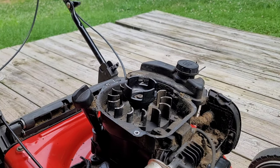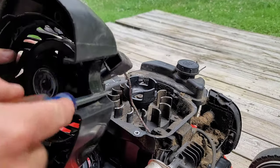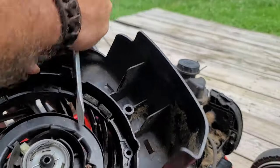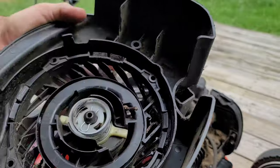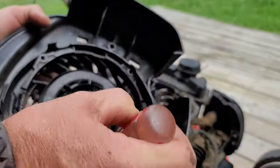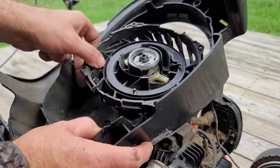Now you're going to need a flat screwdriver. The old cover goes to the side - keep the part number for later. You've got this cut-out right here, and your handle goes to that cut-out when you snap it back in. The easiest way to get these out is not to pry on the plastic - don't do that. There's a little slot underneath these little fingers. Push your screwdriver under the slot, push in, push up, hold it in place. Find the next slot, push in, push up - go all the way around. Once you hit the third one, push in and push up and it's free. Didn't take a lot of prying, didn't take a lot of effort, and I didn't snap anything on the cover.